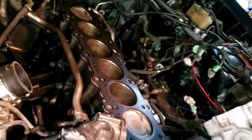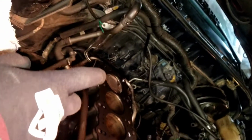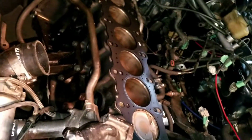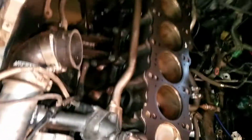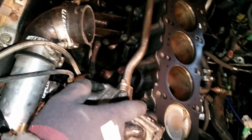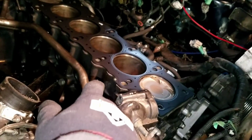So in the Mark III Supra, you have a clearance issue with the rear ARP studs. To make the head easier to place onto the top of the engine, I'll put in the head studs after I get the holes lined up. Then I'll stud them. Be careful not to drop any studs down the oil drain back passages, or whatever those big holes are. You can fish it out with a magnet, but it's not easy.